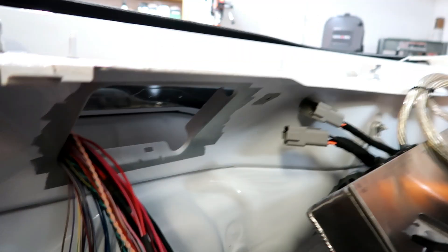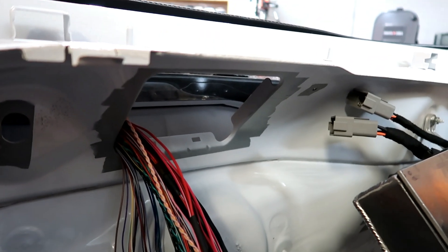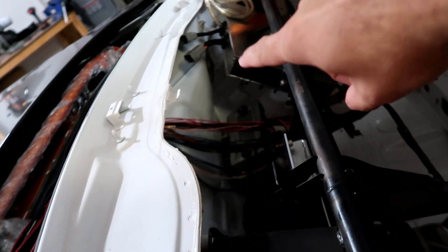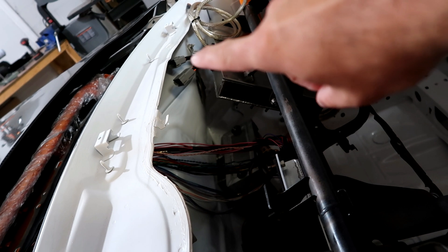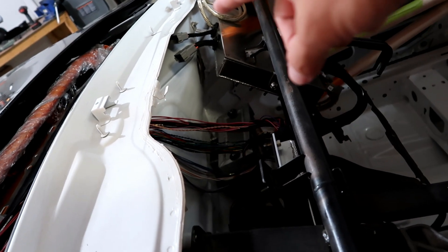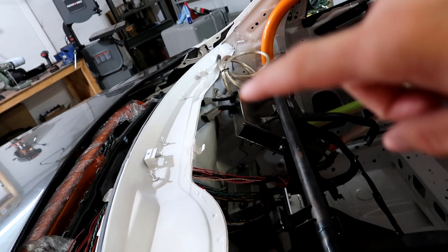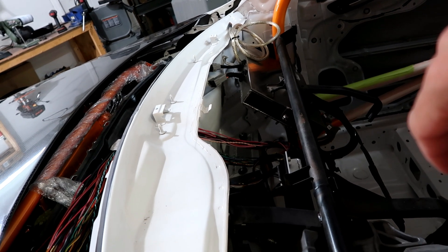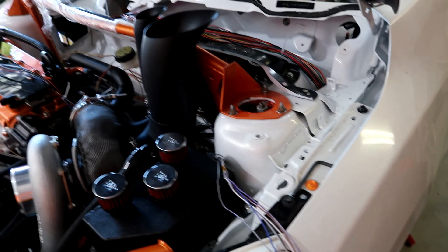The other thing I have to do is make a plate for that hole with a grommet on it. What I'm going to do next is do the plugs — the two on top and the two on the bottom — because some of those cables also go out with these, so I've got to have that done before I wrap up the harness.